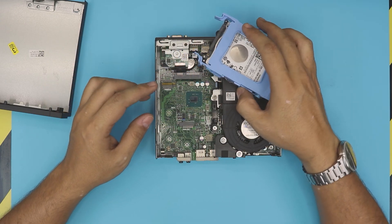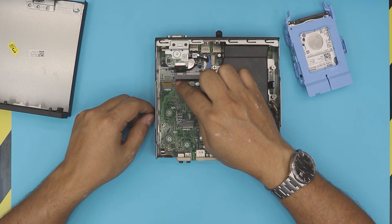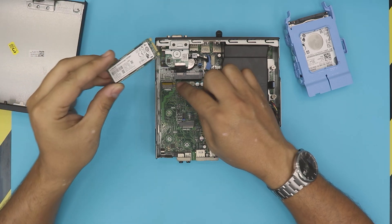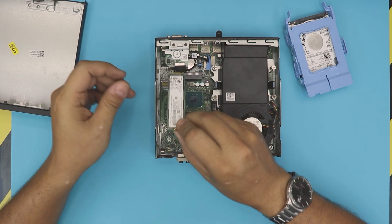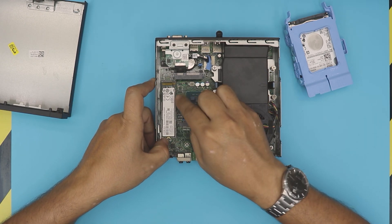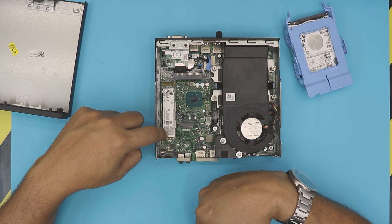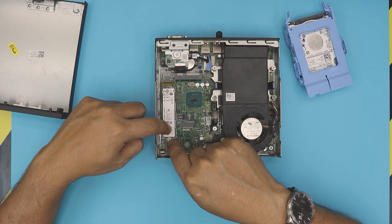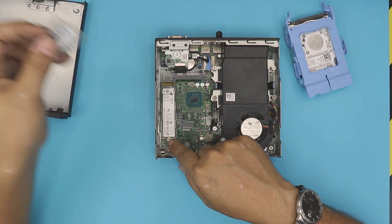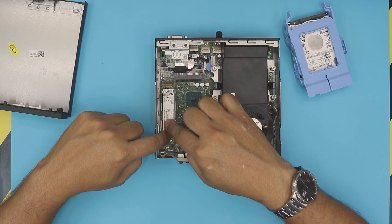Alternatively, you can keep the old drive as extra storage and get yourself an NVMe M.2 SSD. There's an M.2 slot right here — I'll leave the link in the description. Insert the M.2 drive all the way in at a 45-degree angle and stick it right in. You have to put a screw right there; they use a really small screw — I'll leave a link to a screw set for M.2s in the description.